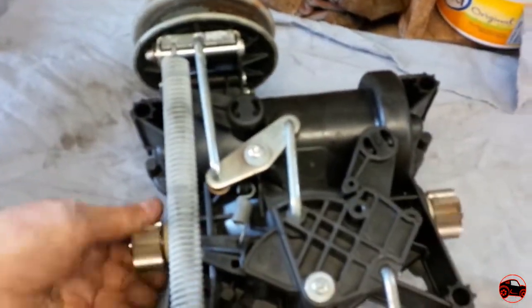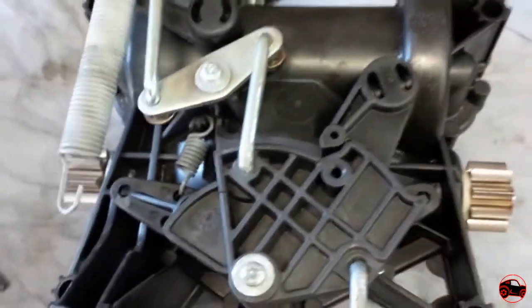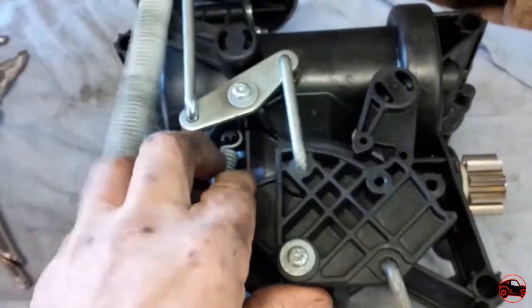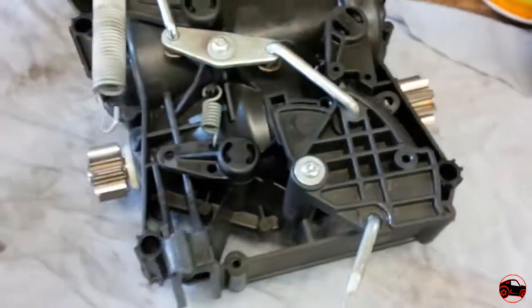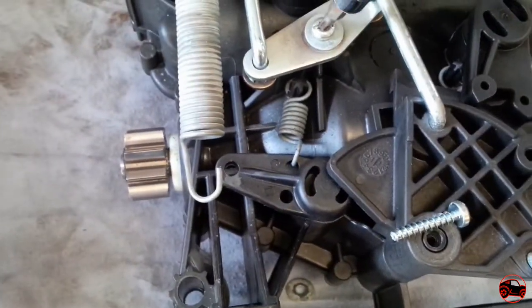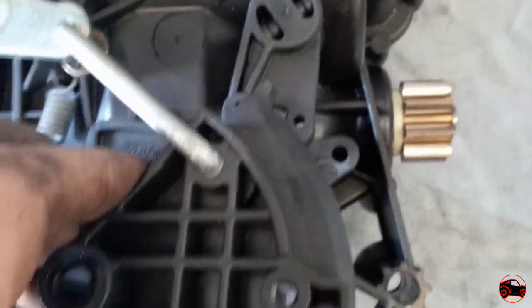In this clip you can see the parts that control the traction. They are assembled on the transmission housing. To transfer the power to the wheels, the engine is linked to the transmission with a belt and two pulleys. The long spring helps to maintain the proper opening of the pulley via the pressure plate. To remove the parts mounted on the housing, I had to begin by removing the main pivoting mechanism. I aligned the apex with the notch and pulled the parts out.